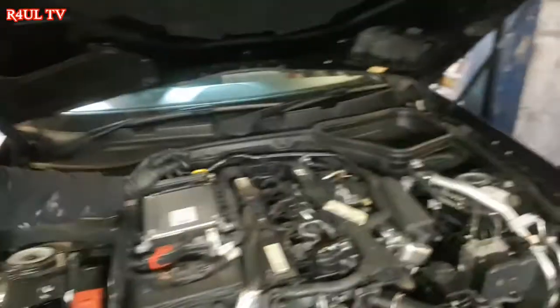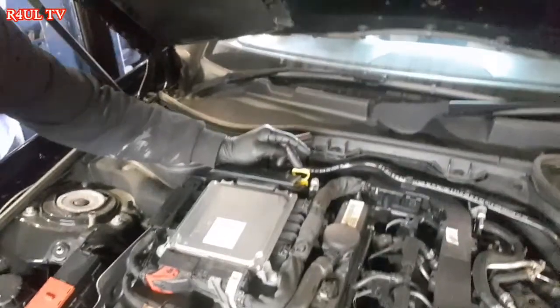The oil is in, everything's all done. The oil filter's on, oil's in. I've checked it on the dipstick, which is here — no problem. Some Mercedes don't even have a dipstick, so just note that this one, the 2.1 litre 2012 Mercedes SLK, takes 6.5 litres. Put 6.5 litres in and you don't need to check the dipstick anyway. Let's start her up.